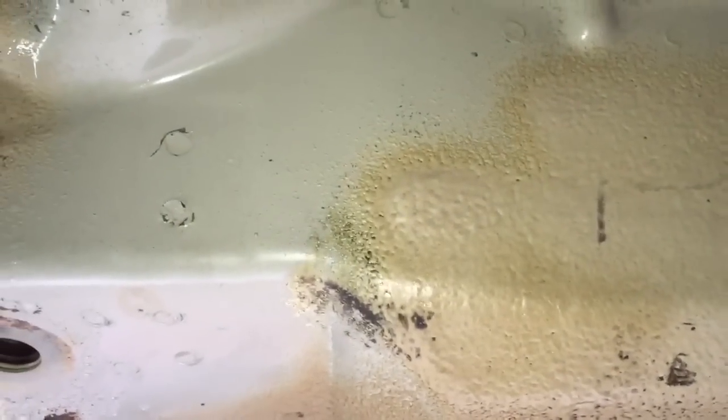So this is exactly why you should clean and degrease the floor thoroughly. What we thought earlier looked like a fairly good mount, a right rear mount. We haven't taken any seam sealer off yet. All we've done is clean the panel. And when you zoom right in, really hard to pick up, but there is a hairline crack. Lost it myself now.